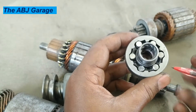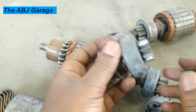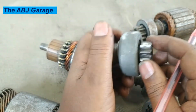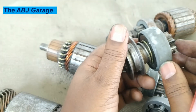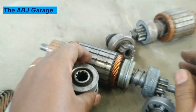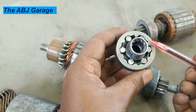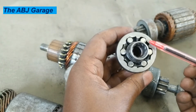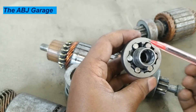If it gets dirty, you can start cleaning — immerse this in some sort of solvent, shake it, immerse it again, shake it — and you can clean it in such a fashion. But if that still doesn't fix it, you can pry it open and repair it internally. We found two of the springs were broken, bought new ones, and replaced the springs.